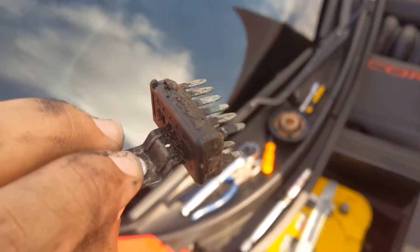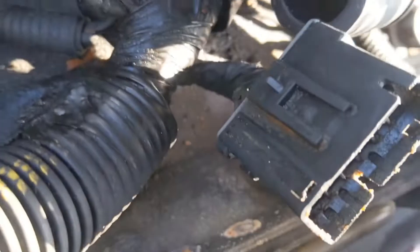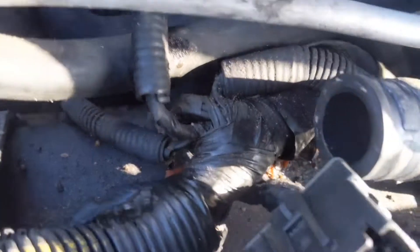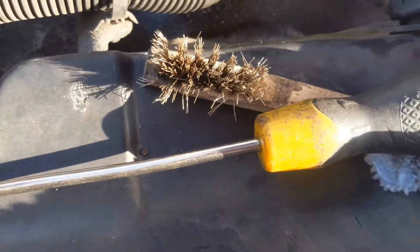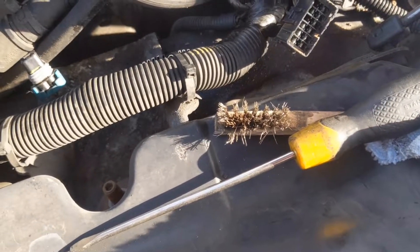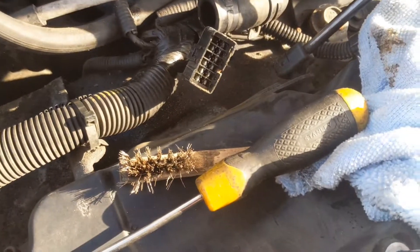As you can see, these are heavily corroded. Those little tabs come up on that side portion — you just lift the tab up right there and slide it through. As you can see, it is very corroded on the inside. We'll note this just because of the location of it. I'll just use a wire brush — I should have got a carb cleaner to get inside there a lot better, but we'll see how good this brush can do. That is gross, and that can cause a lot of issues. There's one here and one right there on that side. Check these before anything if you have any issues with your C5, because they commonly corrode and give you problems. Hopefully this will fix my fog lights, and I think the BCM is that one down there. We'll try this and go from there.